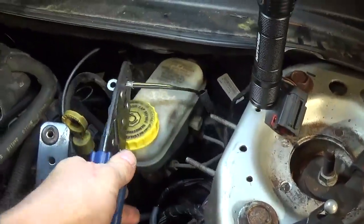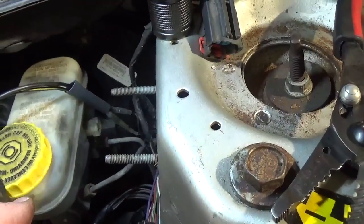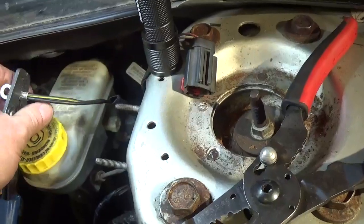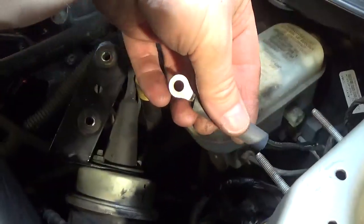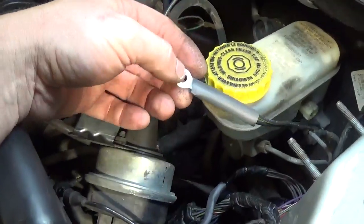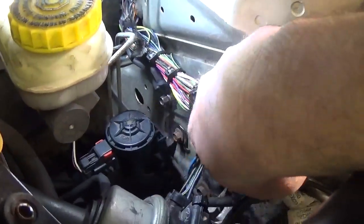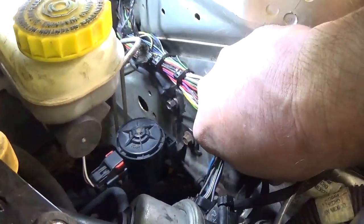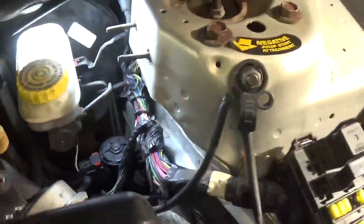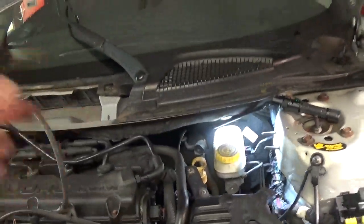I'm putting these two wires together and using crimping pliers for these connectors. The splice looks okay. I put shrink tube over it and it should be all right. That looks pretty nice, I like it. I'm going to put the shrink tube over and put it back together. Wiring is done. The bolt is clean — I cleaned up all the rust, applied some dielectric grease, both eyelets are bolted on, put some zip ties around the harness, and I'm going to put this thing on and be done. I'm going to do a final check, put everything back together. Whew — this was a job. All right, everything's buttoned up, final check.